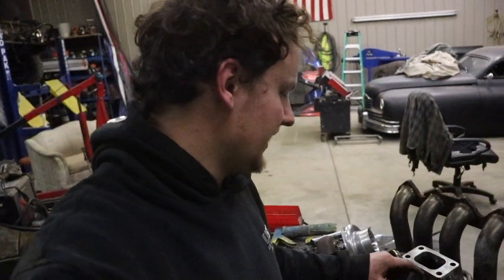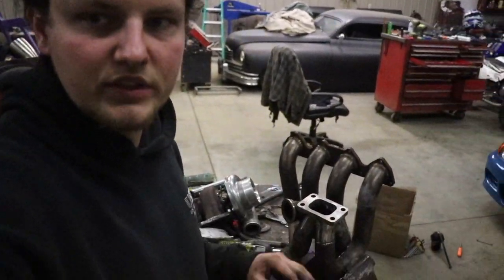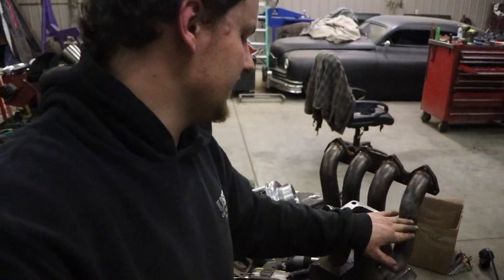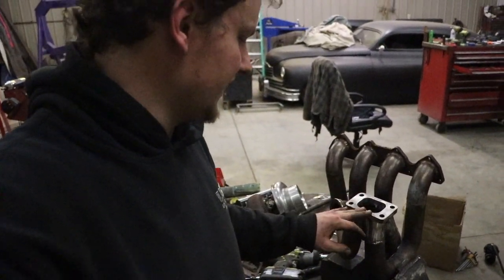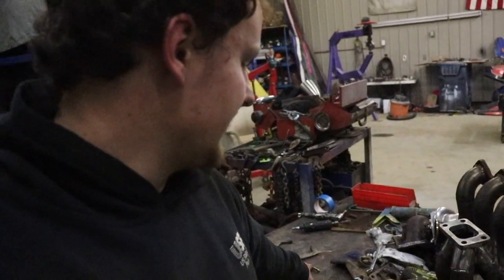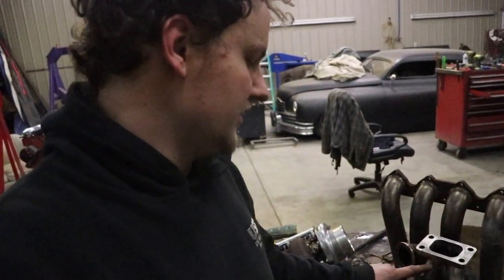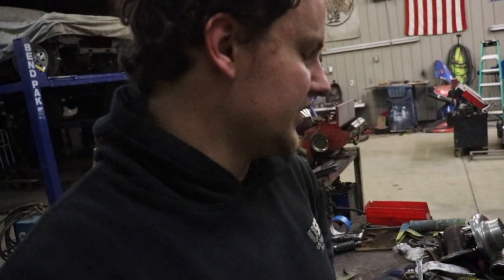So I'm gonna go ahead and fully weld it. I might keep that turbo bolted to it as much as I can to keep this flange from warping, but it should be fine. It's pretty thick, but yeah, and I'm using a 309 rod because this is mild steel and then this is stainless steel, so to mate those up, 309. If it was stainless to stainless, I'd use 308, but yep, so I'm gonna go ahead and tack it some more and keep welding.